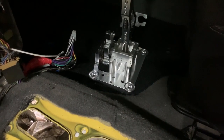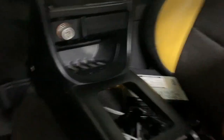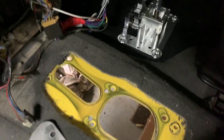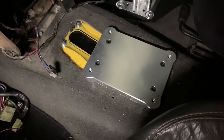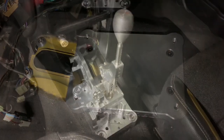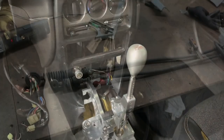For the shifter, I originally decided to put the base plate under the car and mount the shifter on top, however I was having trouble getting it all under the console. The plan now is to chop the console just under here so there's enough room for all the cables. A steel plate goes under there — three mil thick with six M8s — and then the base plate will go down on top of that. The bottom half of the bracket and the main base mount are in place.